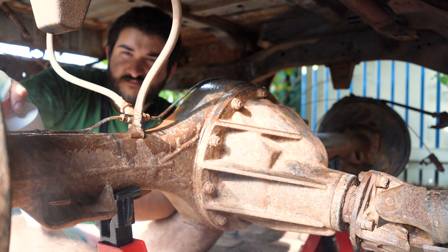So there are three steps to this chassis coater kit — well, three steps in the box but there are sort of four steps in reality. The first step is you wire wheel off all your loose scaly rust, any dirt, or loose paint, and then you start the steps in the box. First of all we've got AquaClean, which is just an industrial cleaner that goes all over all your metal.